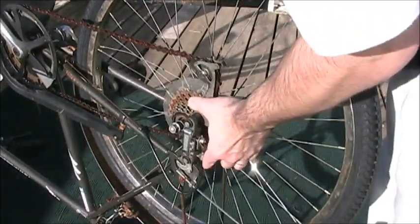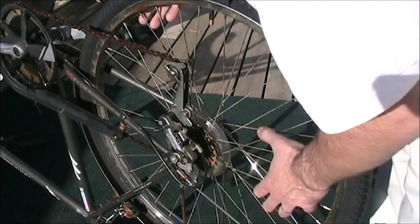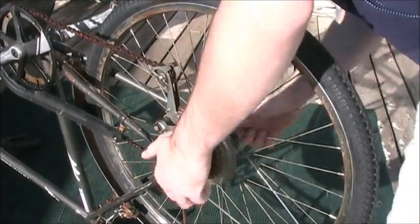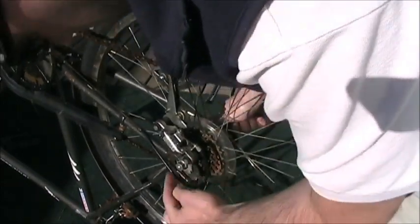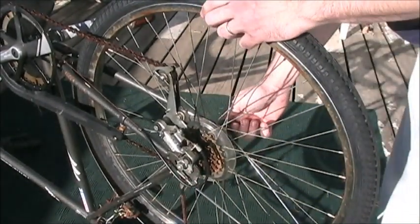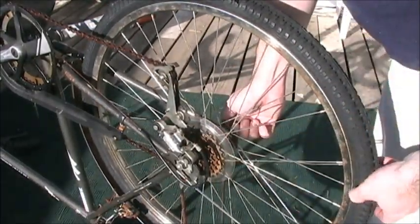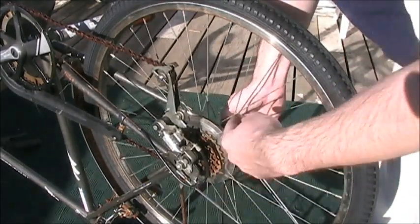Now that we have our new tire on, you'll want to work your sprocket in with the gears here. Make sure everything's out of the way and then rocket it back into the holes. Make sure that everything's nice and square as best you can. With this one there is some play, so you'll want to work it back and forth because this gear mechanism actually uses this to settle. Bottom this one out and then adjust the other to make sure your wheel is straight. Some tires are directional — not such a big deal on the front, you can just flip the wheel around. But on this one, since the sprocket has to be on a specific side, you definitely have to make sure you install it correctly. Once you get it all lined up, redo your brake and we'll move on to the chain.